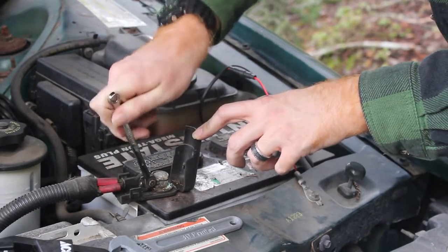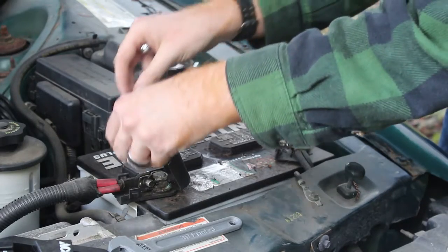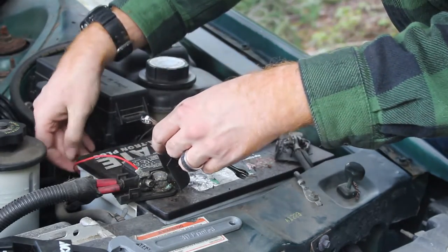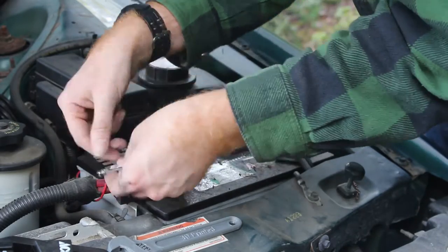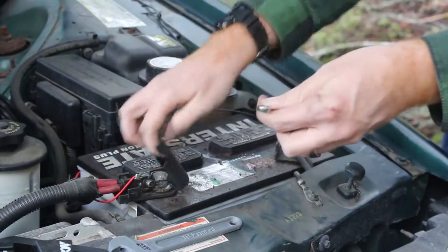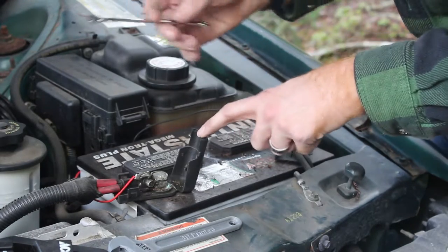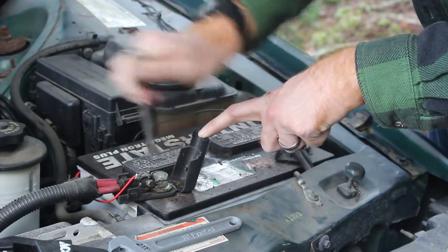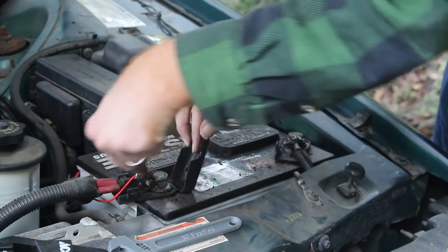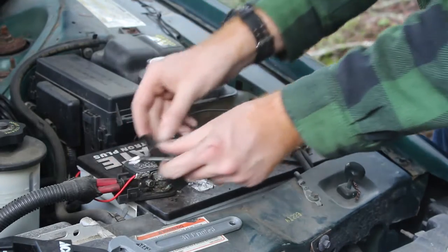Alright, we have a regular wrench now. You want to open it up just enough to slide the wire in there. Run the wiring as best you can, using the actual plastic cover to push it down. Alright, that's in place. Especially when you have metal tools, you want to be careful not to ever touch the positive and the negative side of the battery at the same time, because it will spark and could possibly really hurt if you're holding on to whatever tool that is. So tighten this back up until it's nice and steady.